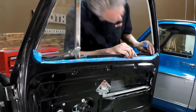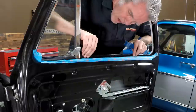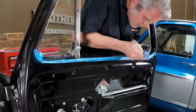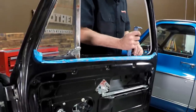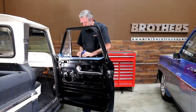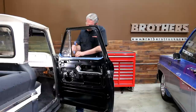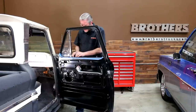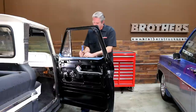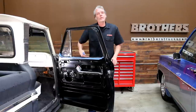I'm going to get lined up with my clips with the window rolled all the way down. I'll get this just kind of set into the strip holes, and use my plastic spatula so I don't scratch up my glass. I'll get it to set in there pretty much where it's going to go and then just push in until I hear it go click. Sometimes I'll even put a little bit of silicone on those just to help it set in and not rattle in the future. It's going to take a little bit of playing with, so make sure you have your tape at the top protecting all of your paint and glass. With one side done I'll do the other side and we'll be all ready to roll.